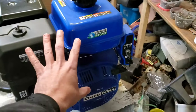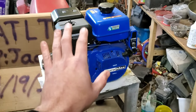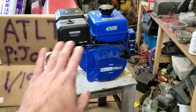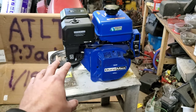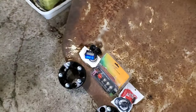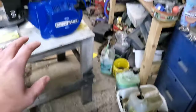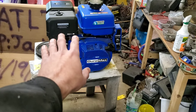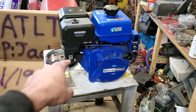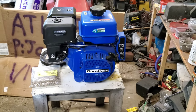Now with these Duromaxes, I'm going to start this up so you can see — when you rev it, these things stock horrifically like to fall flat on their face. So without question, one of the first things we're going to have to do is carburetor mods, straight pipe the exhaust, all that kind of stuff. But none of that is going to happen until we have a tach on it, get the tach installed, and we're able to test what this does stock and what each one of the mods ends up doing. We have a jet kit for the carburetor so that once we straight pipe the exhaust, that will help, and we'll go from there.